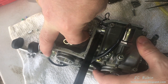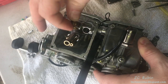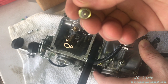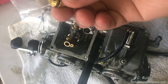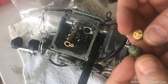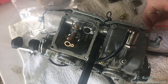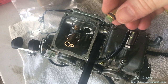Even with a rubber seal on the outside, we should be able to remove this with our fingers. I take it out. Remember I'm replacing this — this one wasn't actually a major problem, I'm just doing so for the purpose of this video. Pull the new one out from the kit. Your kit may or may not include a screen. If it doesn't, as mine doesn't, we're going to remove the screen from the old one and clean it. Pop the screen off and hit this with a little carb cleaner. Everything looks good — I'll gently snap this on to the new one.